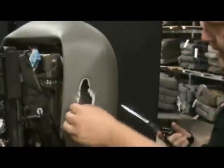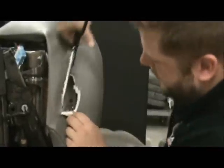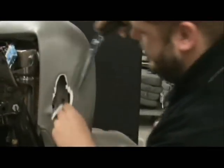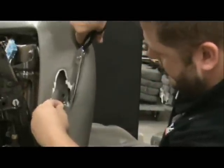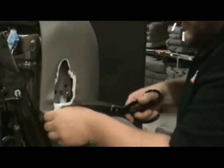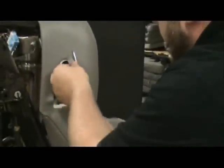I've got about another half inch until I hit this panel, so I'm going to cut down this wall a little bit. Put it down and just see where my inside frame is. You don't want to go all the way to the frame — you only want to leave it about a half inch to a quarter inch over that little metal lip on the inside. This looks like a pretty good start on the bottom portion. I'm going to trim towards the top now. I've got a little ways towards the front — trim up here.